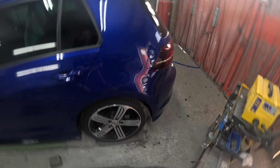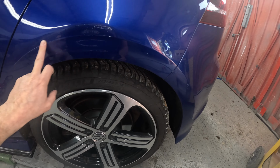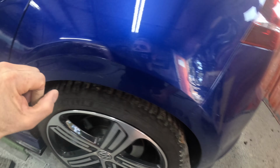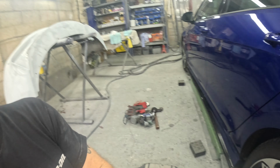So I'll just use the wiggle wire, the wiggly wire, on that feature line, get that into tension, and then start dressing that top. But that pulling tower is a good aid to get tension on stuff if you want to start hitting around the repair. I've got the pads with the puller, and they're good, but you're a bit restricted for space with them.